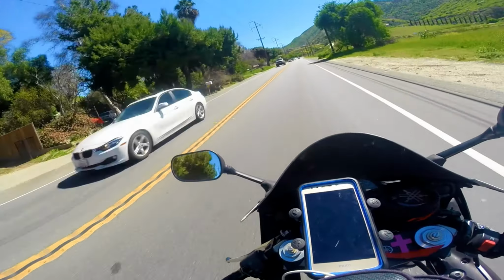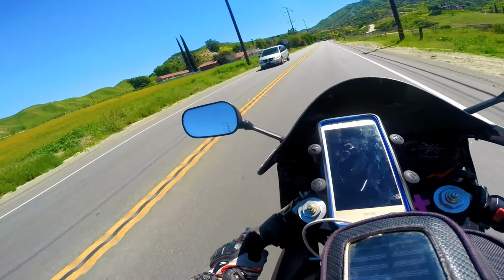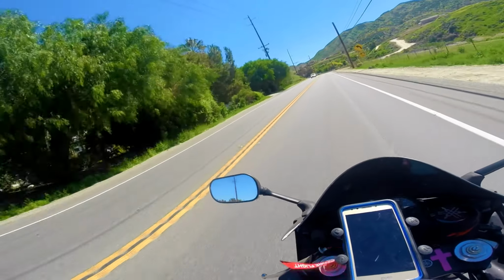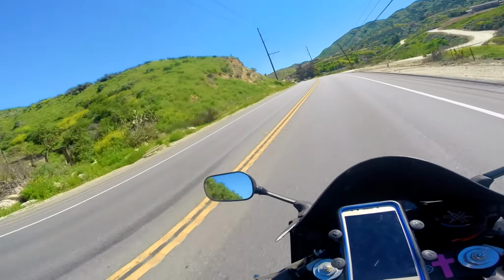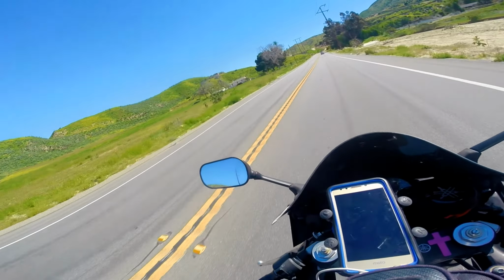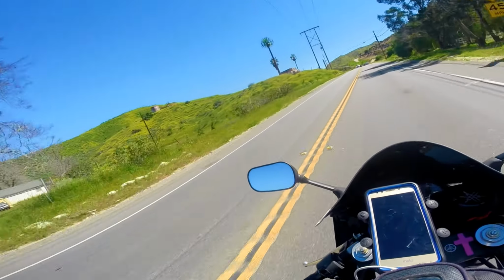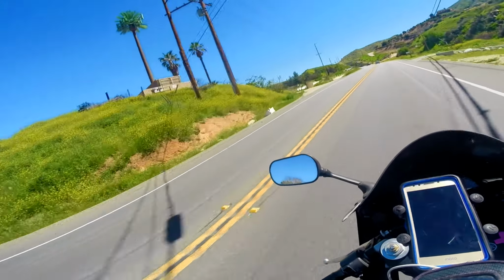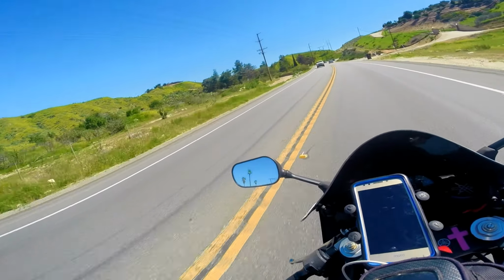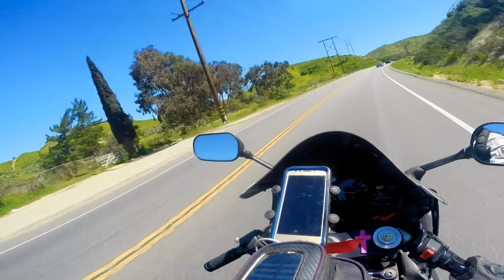So, when you're counter steering, some bikes you're going to have to apply more counter steering than others. I had a Suzuki Katana once, and that one I really had to apply counter steering. It was a big heavy bike. You get a Ninja 400, the new 2019, excellent bike for the twisties. You can lean a lot with that one. That one is just so flickable. So we're going to talk to you about braking also.